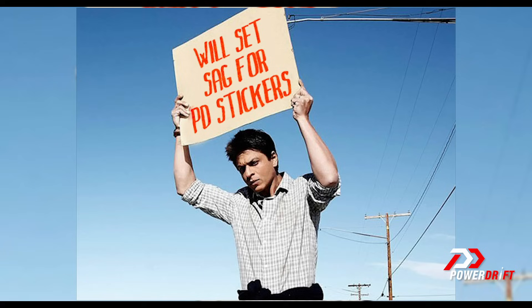If a mechanic is experienced, they'll know how to set sag and do it fast for you. But if you're not going to all that trouble, take a spanner, mess with the preload ring, and see where it leads. There is no right or wrong — what feels best for you is the best setting. For most people, setting sag will help find that best setting faster without as much trial and error.